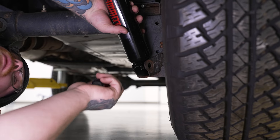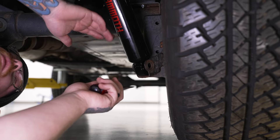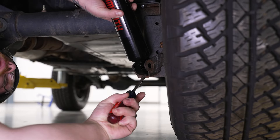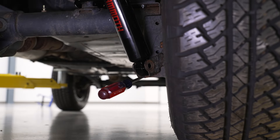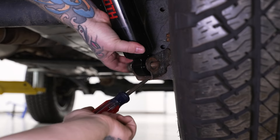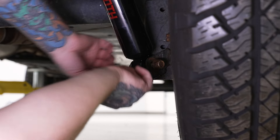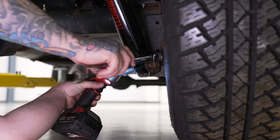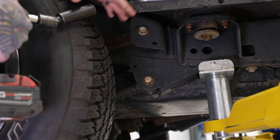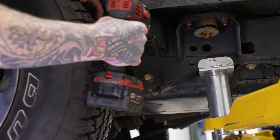Now we've got the wheels on the vehicle and have it lowered down enough so the weight of our Jeep compresses our springs enough to get our shocks mounted. We've got ours a little bit lower than the mount, which is always better than too high. Then we can grab a flathead screwdriver or pry bar, work that in, and get it right back up to its mounting spot. Get our factory hardware back in — grab our 18mm bolt, slide that through, get our 18mm nut on, grab our 18mm socket on our impact and 18mm wrench, and tighten these down. Now our suspension is preloaded again with our wheels on the ground, so we can tighten back down our control arm bolts using our 21mm socket and swivel adapter on our impact.